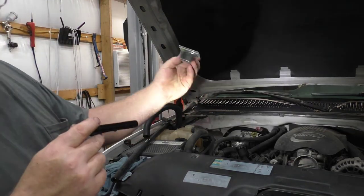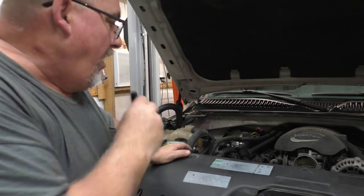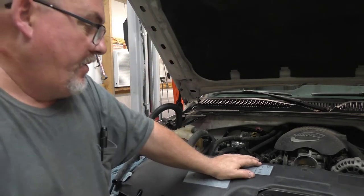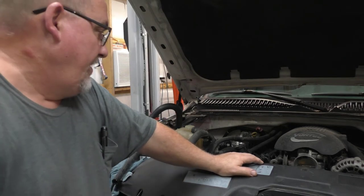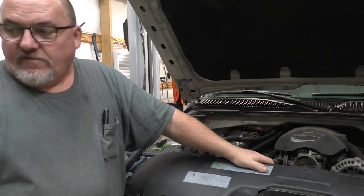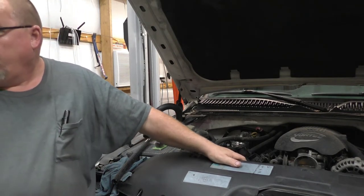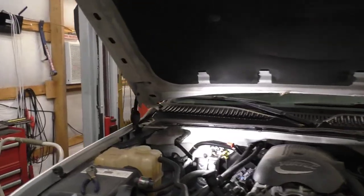This is a push lock here — all you got to do is just snap them in. That's a pretty easy fix. After that we'll do the hose, and after that I'm going to bolt the thermostat back on, put the top radiator hose back on, and then I'm going to bring you along with the airlift again. Every time I use it I can't help saying something good about it — it's a very professional tool. It eliminates a lot of the bleeding problems that everybody is having and eliminates the air pocket. I did some modifications to mine — I'll show you that in a minute when I get the hose on.